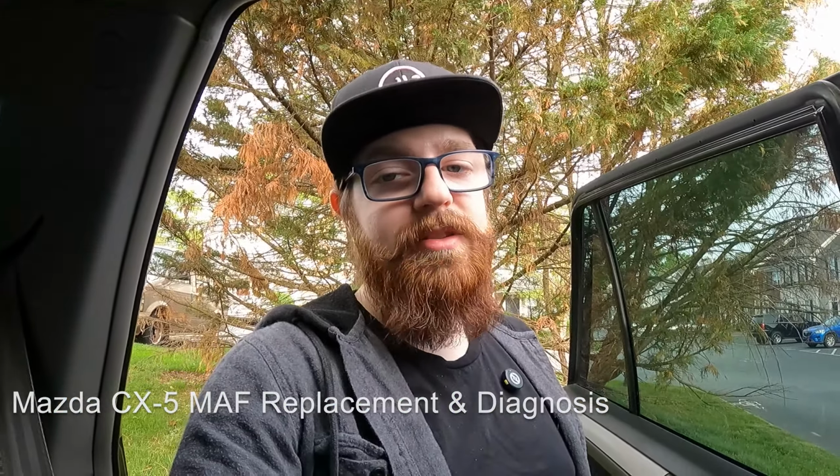Today I'm over at Marcus's place and I'm checking out the 2013 or 2014 Mazda CX-5. There's an issue whenever it goes into drive that it just stalls out. It's been having some weird issues. I guess it's not really misfiring, but it won't stay running when it gets put into gear. But if it's in park or neutral, it's fine.